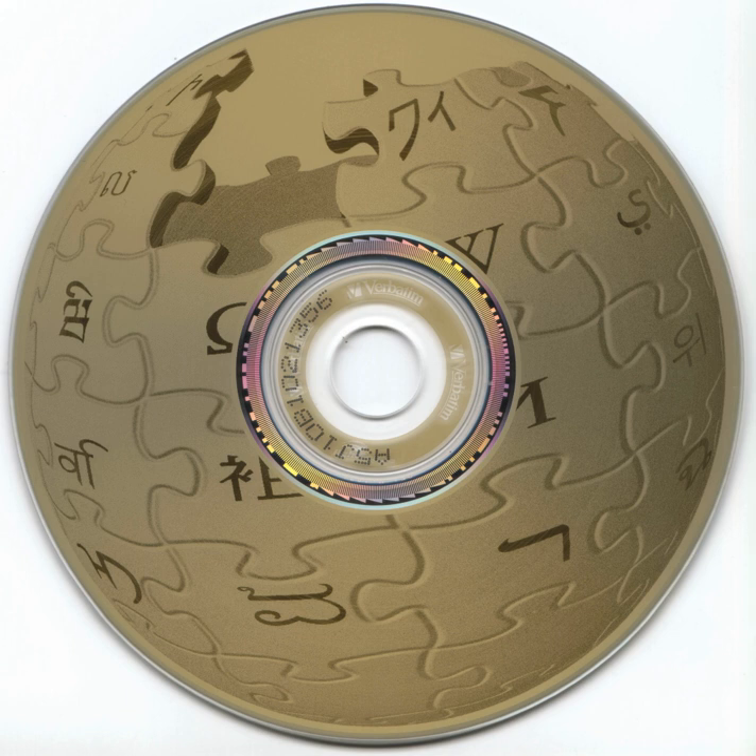LightScribe labels burn in concentric circles, moving outward from the center of the disc. Images with the largest diameters will take longest to burn. LightScribe is monochromatic, initially a gray etch on a gold-looking surface. From late 2006, LightScribe discs are also available in various surface colors under the V1.2 specification, though the etching is still in shades of gray. It is not possible to replace a LightScribe label with a new design, but it is possible to add more content to a label that has already been burned.